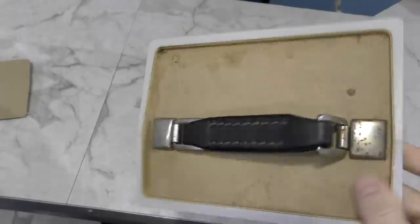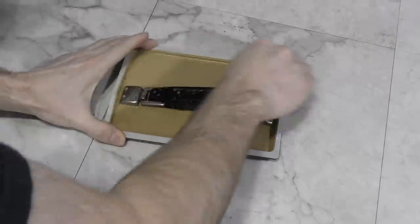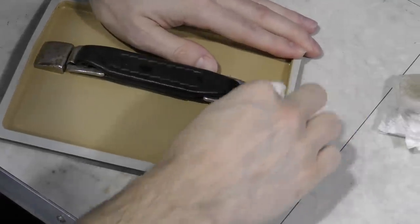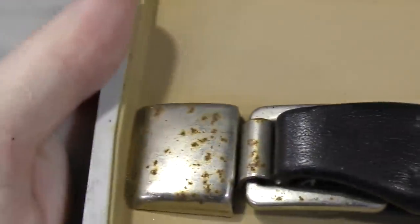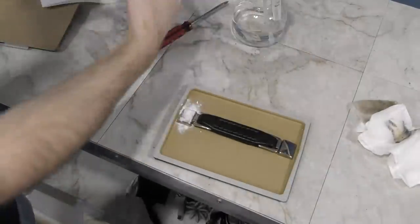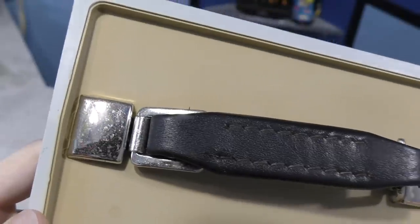Next, I'm going to take a look at these two smaller pieces. This is the carry handle for the computer, and this piece here is the power port cover. It's really too bad I can't unscrew this handle from the plastic — it appears to be riveted in place. So the first thing I'll do is just clean it up as much as possible, and it already looks tons better. The little metal covers are also all rusted up. I scrubbed one here with just alcohol and managed to clean it up quite a bit. Then I came back and followed that up with some baking soda and worked it over with a toothbrush for several minutes. It's not bad actually — it doesn't look new, but it looks much better.